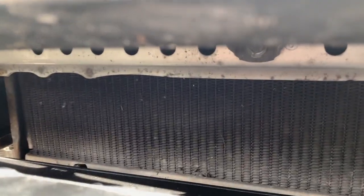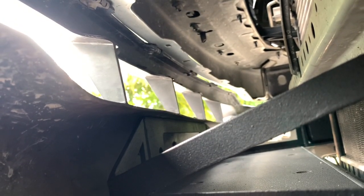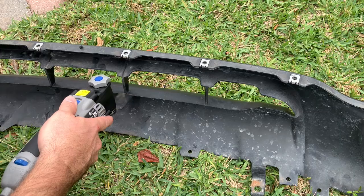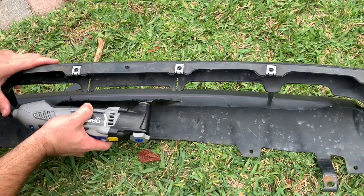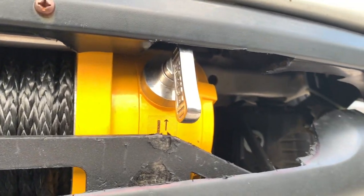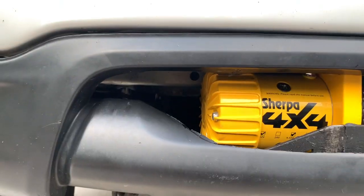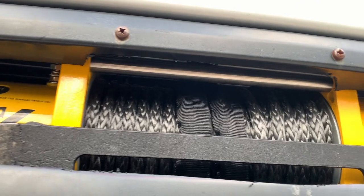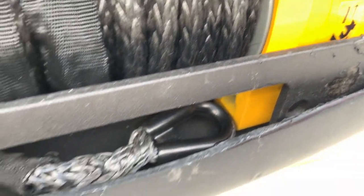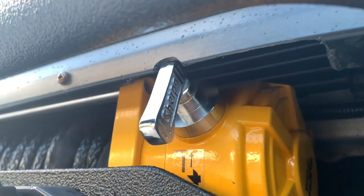Now I've got to figure out how to cut the lower piece of the bumper. I installed it temporarily to see where the bracket is touching it, made some markings — you'll probably wind up doing a lot more marking than this initial pass. I used a Dremel multi-tool and just started cutting carefully. If you mess up, there are replacement air dams on eBay. I did have to cut into the metal of the lower bumper in order to get the piece to fit and for the clutch handle to move freely. I put the bumper on and off multiple times just to check alignment. It was still a little tight at the clutch handle, so I cut out some more plastic to give it more room to move.